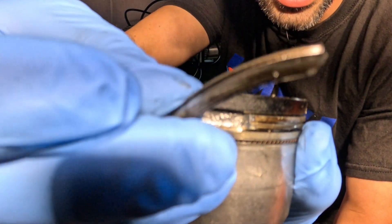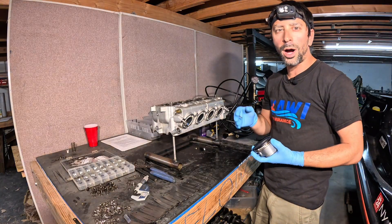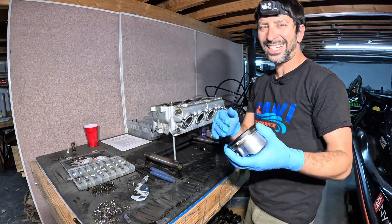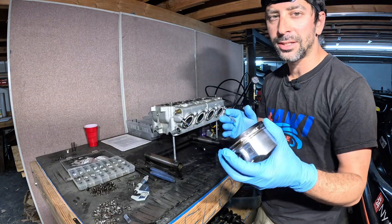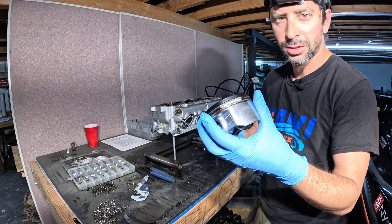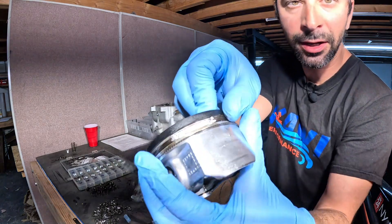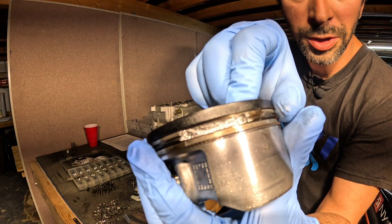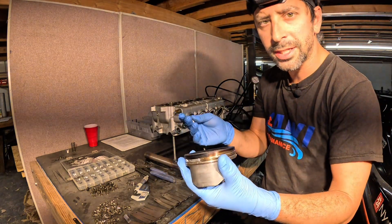Here's the piece that came off. You're going to ask: why does Kawasaki still make these crappy pistons? Well, technically this is not Kawasaki's doing — it's actually not a bad piston. They did make a revision over the years and changed to these pistons. The actual ring land on the top is thicker than the bottom, which it used to be pretty much almost in the middle, if not a little bit higher.